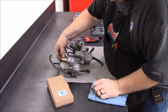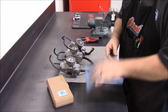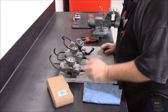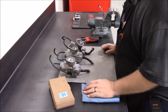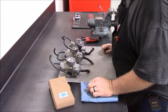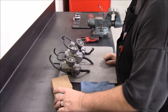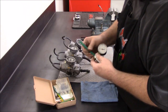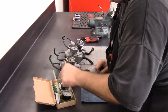The things you want to check for especially are the jets — the pilot jet in particular because the pilot circuit is smaller, so it's usually the first one to plug up. Also check your air bleeds. I've got this Walbro kit that I've had for about 30 years. I've replaced the line on it a couple of times. It's for small engines and has a little slide hammer for pulling the seats out of Tecumseh, Briggs, and Walbro carbs. I've got a little pressure gauge here too. I'll show how to disassemble them, clean them, and then show reassembly and how I set the pressures for the needle and seat.